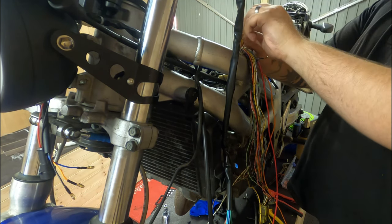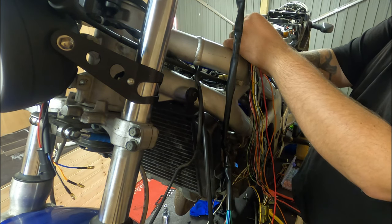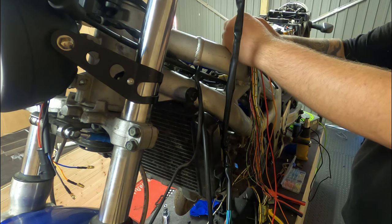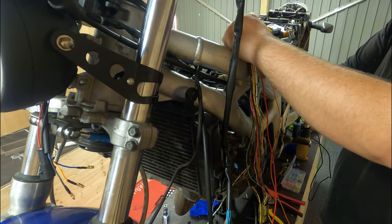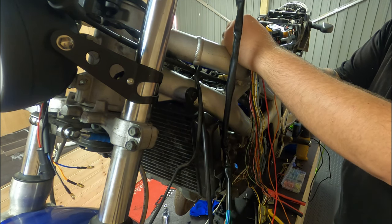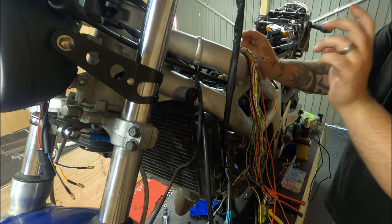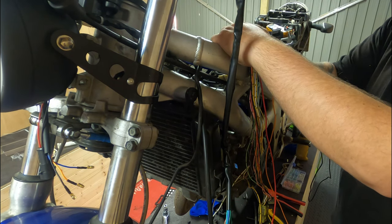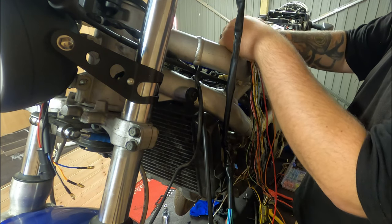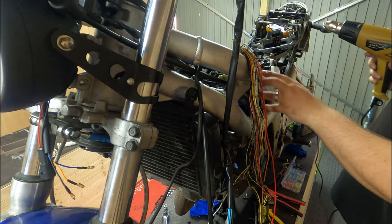A good example: this morning on this bike, I recently had to change my ignition. I've got an aftermarket ignition listed for a generation 1 SV650. Put it on the bike, turned the ignition on, and the rear tail light came on — I was sitting there going, well that's not right, because the switch is off and the lights are on, nothing else would work. What it turned out to be was that the connections on the inside of the ignition were completely wrong for this bike. And the other issue I found was that, even though this is listed for this bike, it doesn't have a resistor inside of it, so now I have to get a resistor to bypass the security to make this bike spark again so it can actually start up — which I now have on order. Considering it's listed for this bike, it should have already been done.